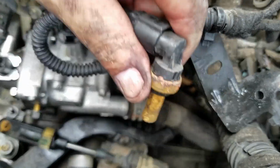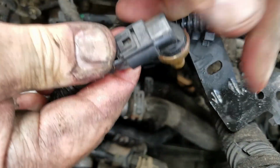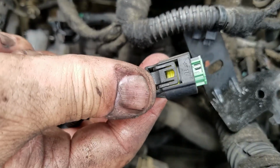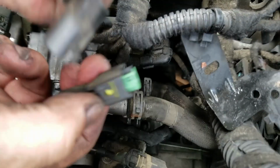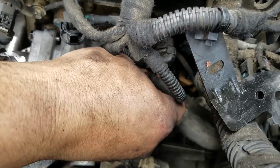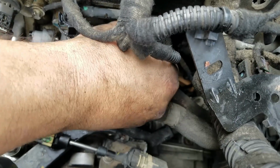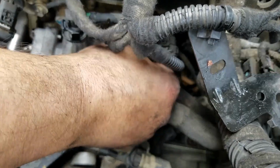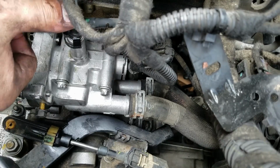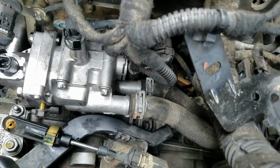Now remember, this is with the clip that I took off the original one instead of just disconnecting, because it was easier for me to unplug the sensor out of the assembly. But now I can install it onto the new sensor. There we go. That one's already installed. The fitting on this hose is broken, so I will demonstrate how to replace it later in this video.